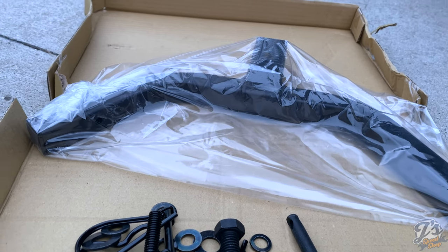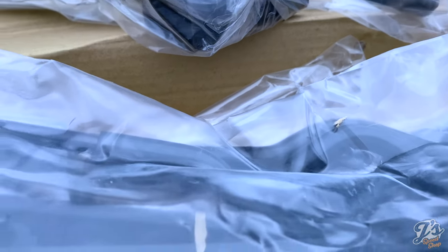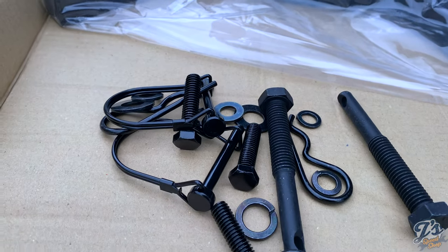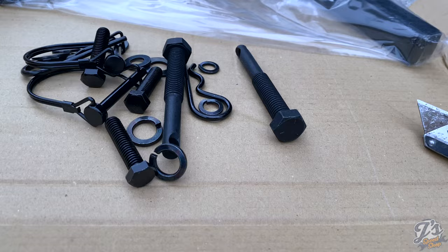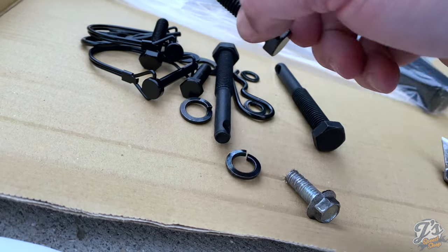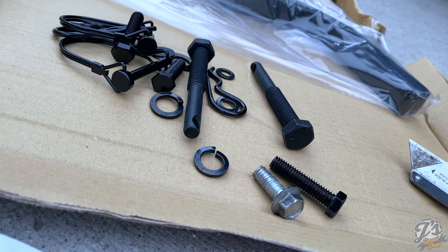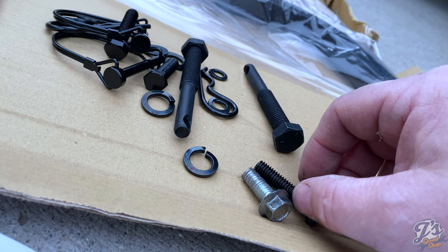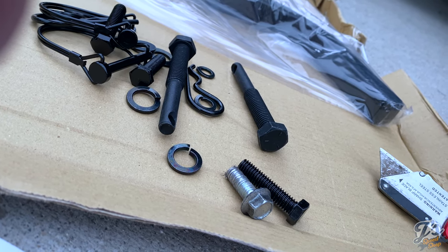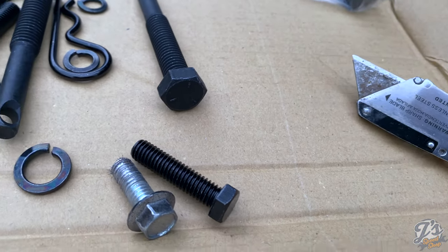Here you can see the hardware kits opened up. This one is mostly all the arms for mounting the bikes themselves. This is the additional hardware: standard screws and longer replacement screws. The frame is actually threaded so there are no nuts — they also send extra washers to help support the bikes. Make sure you use their screws because the factory ones won't be long enough.